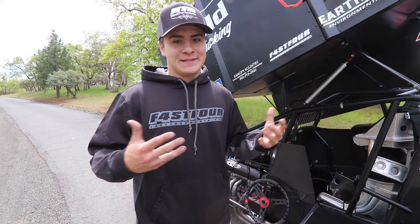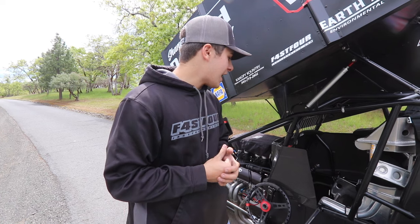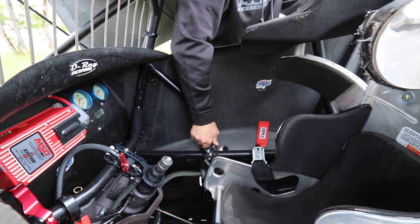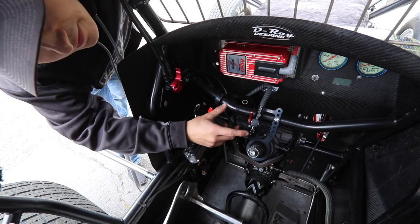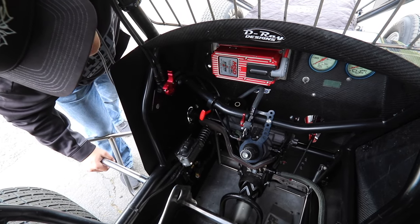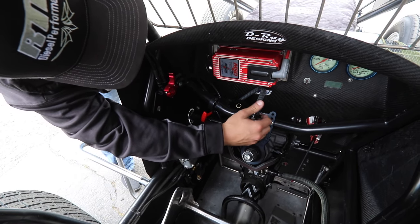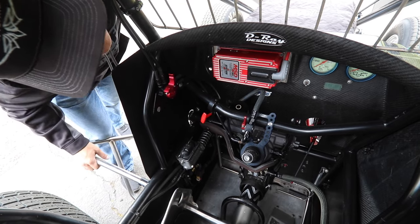The fifth and final step: at some point you're going to want to stop, whether that's coming back to your pit, there's a red flag on track, or you just need to shut her down. While giving it a little gas, you're going to pull the car out of gear so now it's in neutral, and you can use the brakes to roll to an easy stop. The most efficient way to shut it off is to turn the fuel valve up into the off position, which basically runs the engine out of fuel and it shuts off on its own.